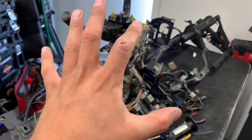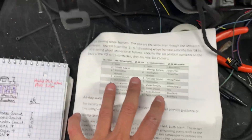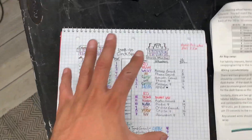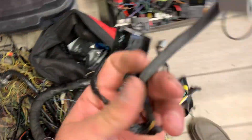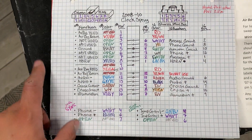I sat down and went through each pin in here and figured out where it comes out and exactly how this clock spring functions. This is what I came up with. This plug is this plug — you see how they kind of look the same — and then this plug is on the steering wheel harness. Since this is a 16 wheel, I'm going to pull those pins out and put them in an 08 plug. So this is an 08 plug and then 2016 wires — this is how it works.